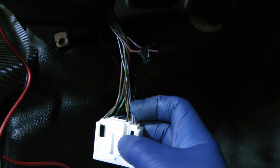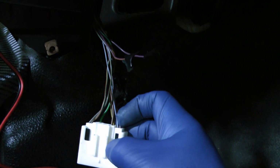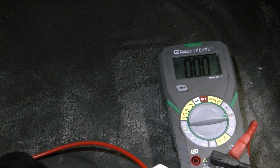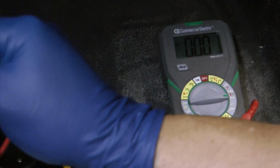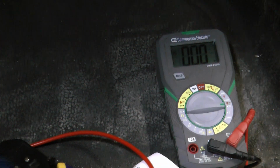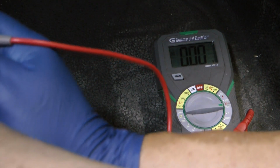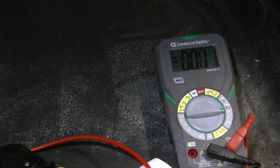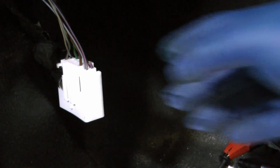If you know where they're most likely to have been cut, that would be helpful. If you can leave a comment on here. They call this the police connector, this baby blue that I'm kind of pointing to. It's hot when I touch the brakes. I will try to get a shot for you without blocking the camera, hopefully. So you see it's 13, and then with the brake pedal not pressed, we have 0. So at least to here, it's working correctly.